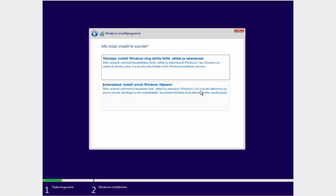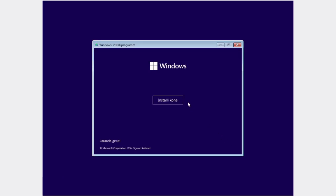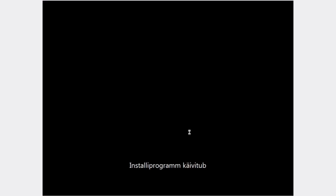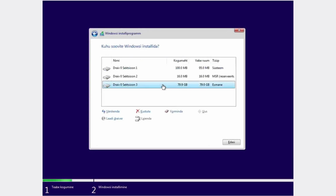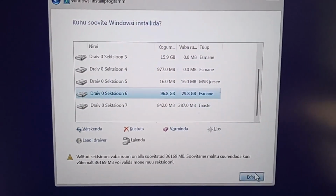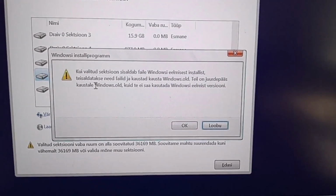Here it simply lets you upgrade Windows and keep the files, only to tell you to upgrade in the existing installation instead of in the live media. Then it just puts you back to the start. So we're again stuck with a clean install. Here again is a partition selection. If you install it over an existing Windows installation, the old installer will not erase the files.